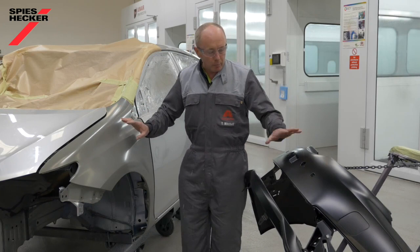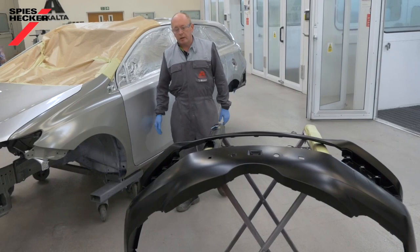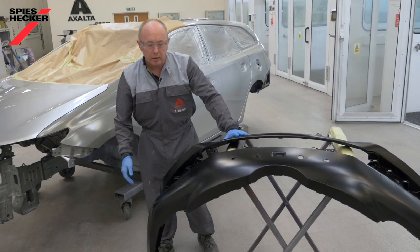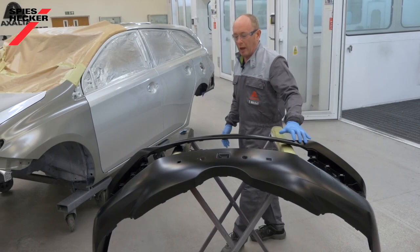The main focus will be on preparation of both the plastic part and the new fender, and I will recap the application of the base coat as we go. Sometimes we can be lucky and the bumper will arrive pre-primed — in that case you would just need to sand it lightly and apply base coat colour directly. However, I would still recommend that you apply a coat of our Primer Surfacer to help with base coat coverage and to provide a more stable substrate.